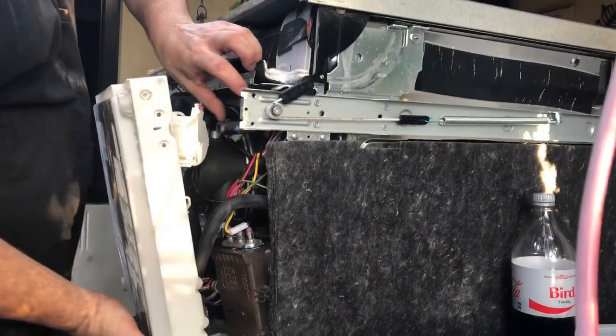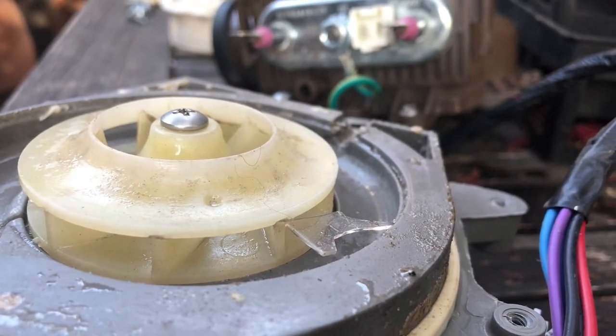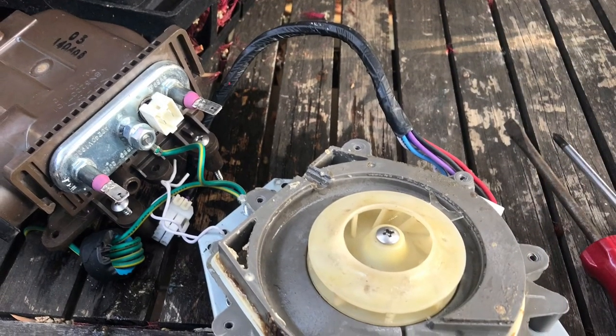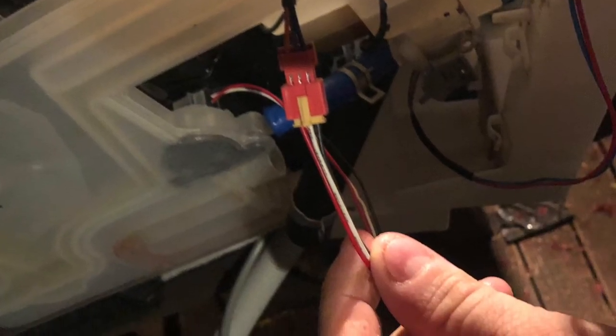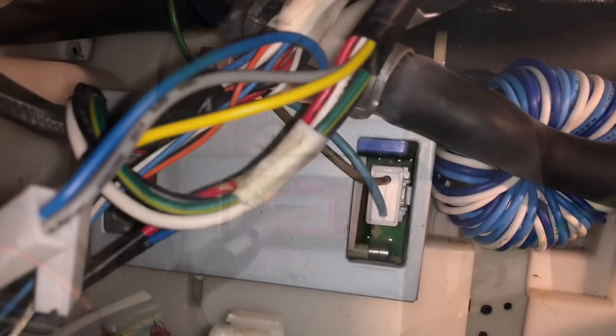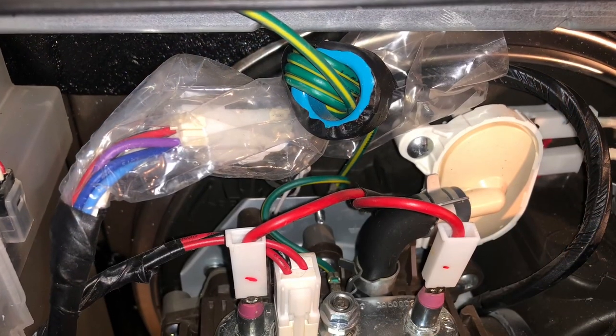We'll come back. Well, there you have it, YouTube. What was an LE error was a piece of glass stuck in the main pump drive motor for the machine. If you're wanting more detail on how to pull apart or put back together again, I've included some still photographs here of wiring, of selections, etc. That should help you identify which wires go where. Also, don't forget my previous video on the OE error, which was when the siphon drain motor was running, but a peppercorn had stopped the one-way valve from operating and getting the siphon started. So there we go, two free ways to fix an OE error and an LE error on an LG steam dishwasher.